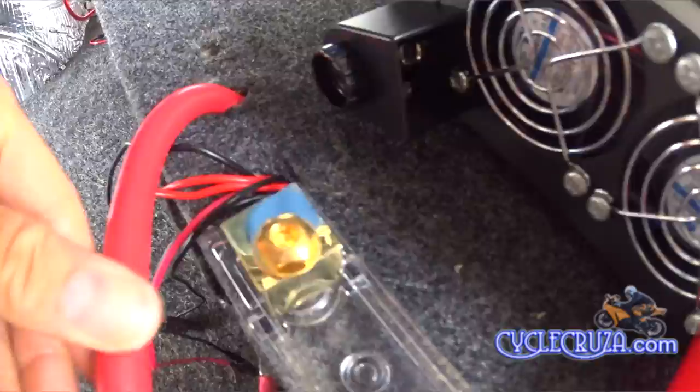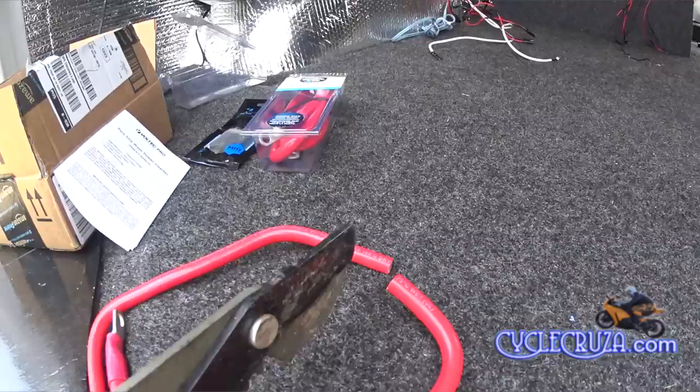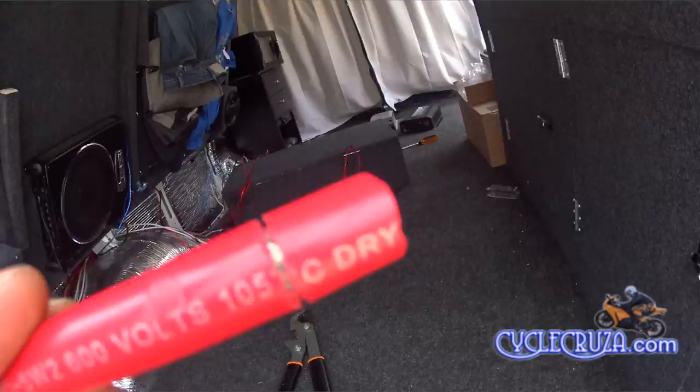Let's mock it up on the battery box — and that's exactly where I want to put the fuse block. Now it's time to cut the positive cable. I just use a trimmer and cut it right in half. To strip the end I use a utility knife — try not to cut too deep because you don't want to cut any strands. You cut around it, then use some pliers and pull the end off. Comes right off, no problem.